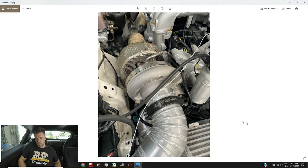The car is also fitted with a pair of Turbosmart external wastegates. In the FD RX7 chassis in stock form, the Turbolon kit dumps to atmosphere — we can't do that road legal in New Zealand, so there's quite an intricate exhaust system plumbing those to the rear of the car. The EFR 8474 also incorporates a built-in recirculating valve swapped to a Turbosmart unit. On paper, that turbo is good for somewhere between 800 and 900 horsepower.